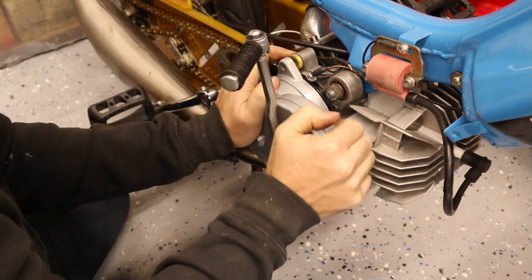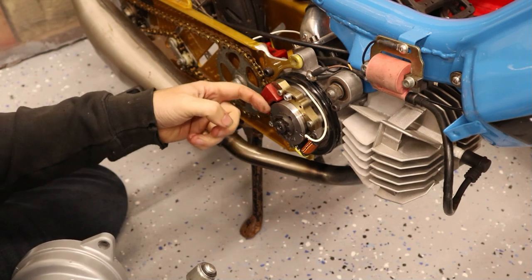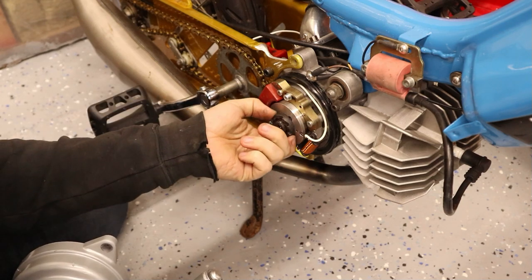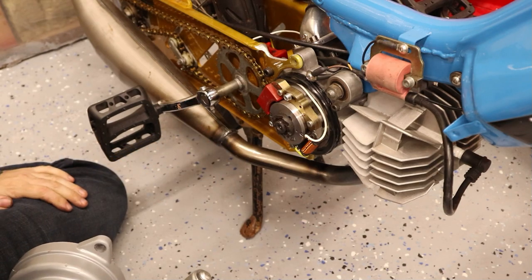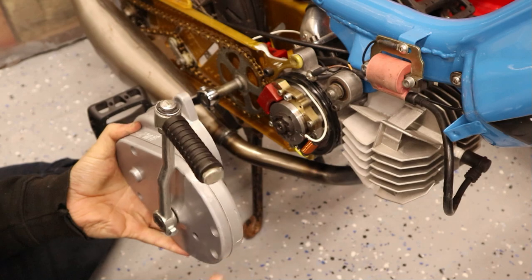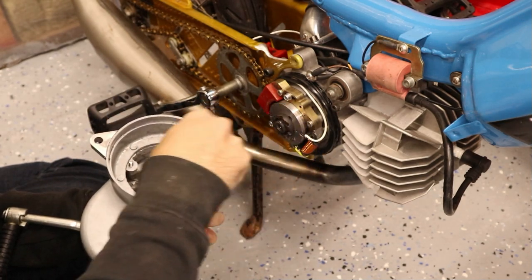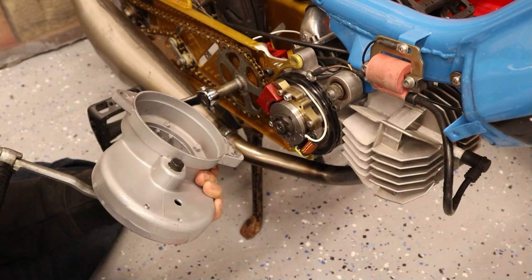I had an inner rotor on here, so I actually had to machine the face down flat, which got rid of the hex on there so that it would get on there with enough grip. But it does work. There's enough clearance that the pawls don't drag when it's running — which is really the only thing you have to take into consideration: make sure this isn't dragging on here or spinning while the motor's running, because it'll just wear everything out.